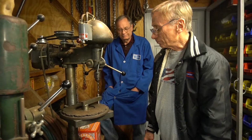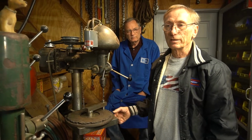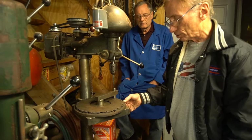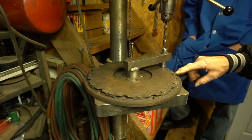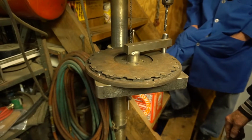Okay, well, kind of with that in mind, Ray, why don't you show us the process that happens when we bolt the flywheel together? Okay, before we get into the step of what I do for the rivets, my first process in doing the flywheels is taking them to my solvent tank over on the other end of the building, and I clean them up a little bit so I can inspect them for any obvious damage. Either bad clutch holes where they're stripped out, which happens occasionally, and that can be repaired. And also extreme damage to the outer edge where the rivets are. Sometimes they've been welded.